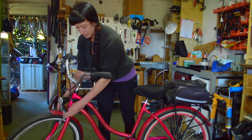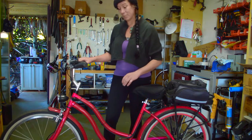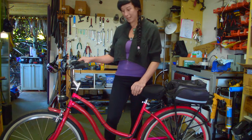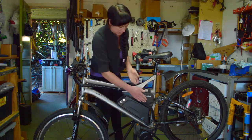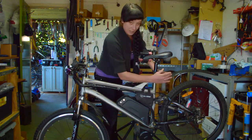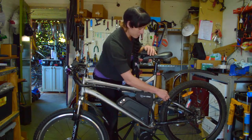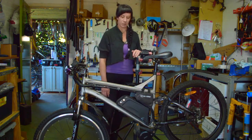The front brakes are the centre pull type — they're really a bit rubbish. We did replace the pads at least, but probably my suggestion would be, if you are putting a front wheel motor on, that you have reasonable side-pull caliper brakes so that you can stop in a hurry when you need to. This being a full suspension bike, we're very lucky to have enough frame space here to mount one of the frame-mounted batteries. It is getting a bit tight with the controller, but that's fine. It's not possible to mount a rack battery in a secure way with the compression at the back end — if you were to use mounting points down and up here, you'd be defeating the purpose of having rear shocks. So it's always worth having the frame-mounting battery on a full suspension bike.